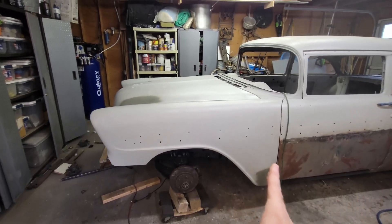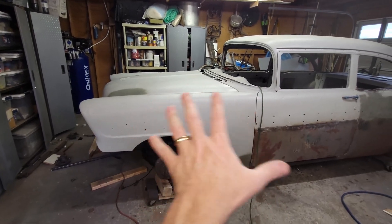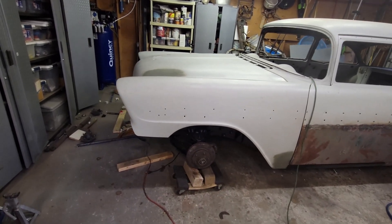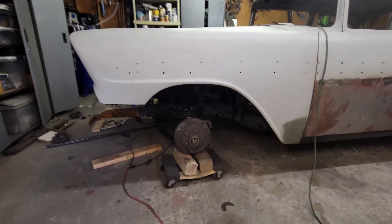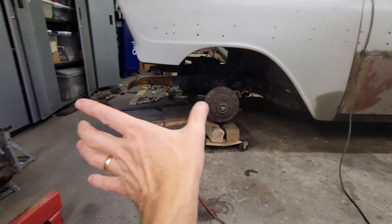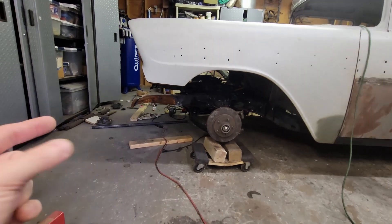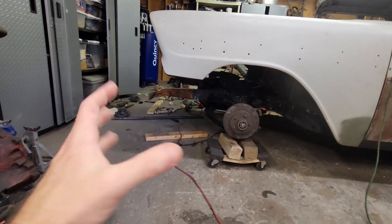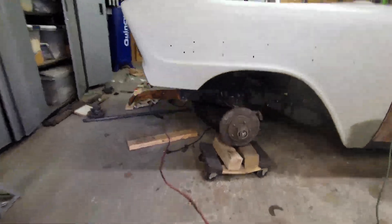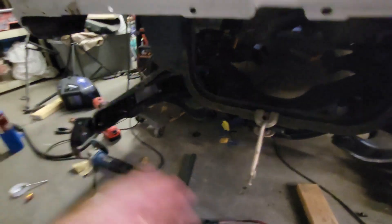Last episode, we fit the front cap onto Christine and got all the fender gaps, door gaps, and hood aligned — at least roughed in enough so that when I do final assembly before body filler, it'll all work out. But if you remember when I painted the frame with POR-15, I left one bumper horn — the frame horn on the driver's side — uncoated because it was bent and wonky. So I have to test fit the bumper, get the two horns straightened and aligned, and do a little welding on the frame. Today is about repairing that frame horn and getting the front end one step closer.